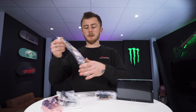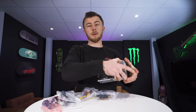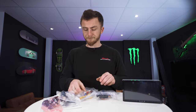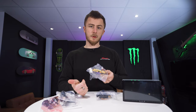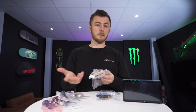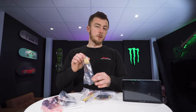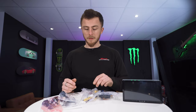Next you get this big long RCA adapter plug, which is because you don't have RCA directly on the back of the unit — this keeps the unit nice and shallow. You have front, rear, and sub three outputs, and then you also have a front camera input and rear camera input, so you can add an Alpine or even a universal parking camera. You also have a video input and video output harness on an RCA, so you could add an extra screen or run something via AV.